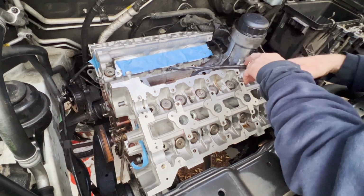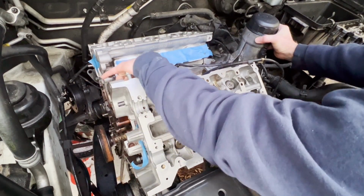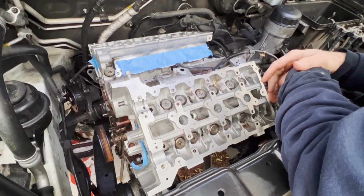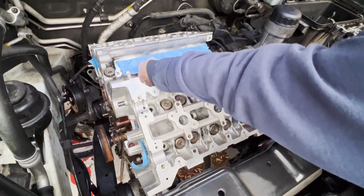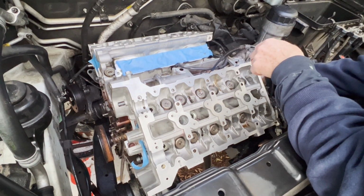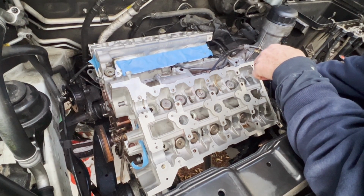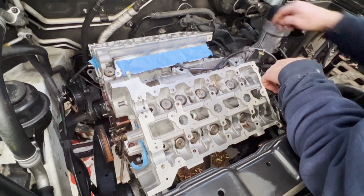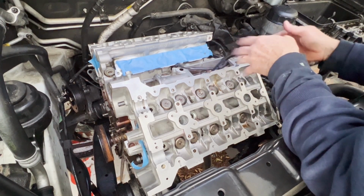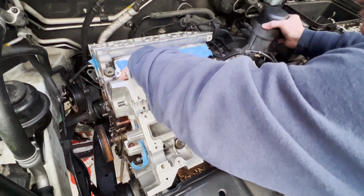So let's say you left it out, or let's say you even had it slid over. Now that slid over that way easy, but remember, there is a gasket that goes up under here. There's an oval gasket that goes up under this end, and there's a rectangle and then kind of a triangular shaped gasket together on this end. And let's say you wanted to slide this in after the fact, that you just left it out and then you wanted to slide it in.